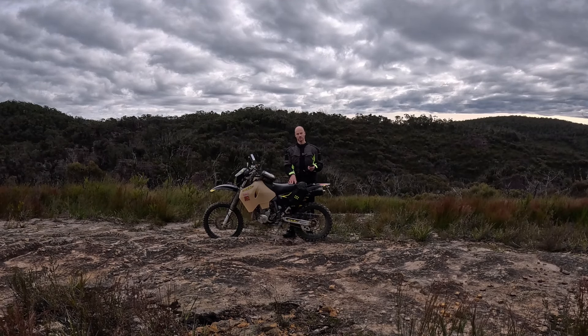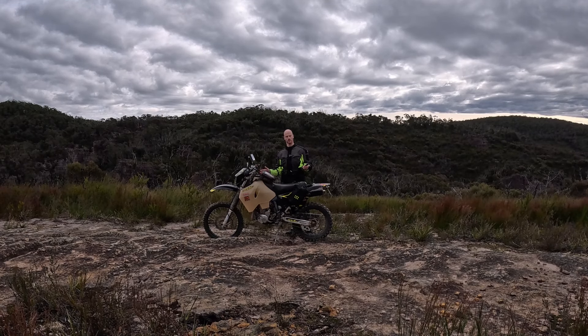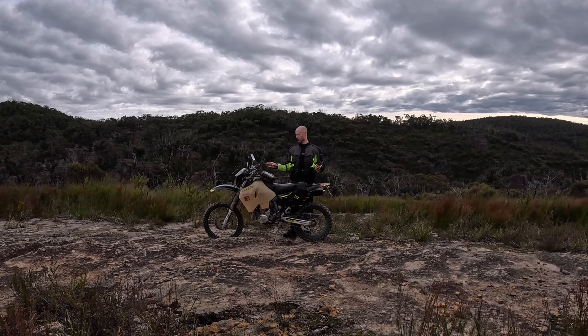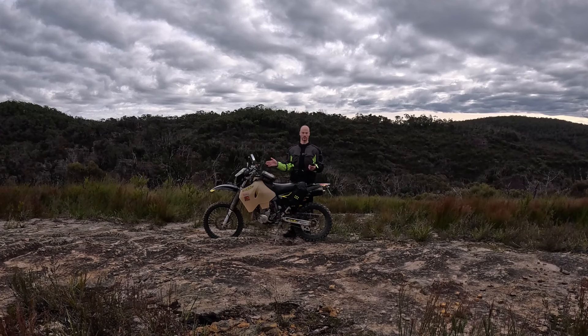As a result of those stats, Sally's new setup: I've got a rear 6.8 spring, up from a 6.4 — I never knew I had a 6.4 and never knew it wasn't doing the job. I just had the preload cranked up and relied on that. My front forks are 0.54 and the suspension has been revalved accordingly. According to the latest service that was pretty good, however there was a broken O-ring in the bottom of my suspension — turns out I've probably had no dampening, or next to no dampening, this whole time. The O-ring was fitted six years ago and I may well have been riding with a broken seal for six straight years without knowing.